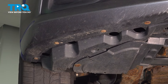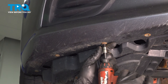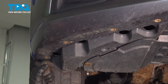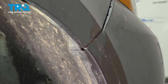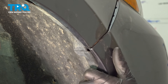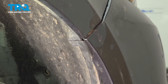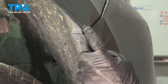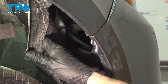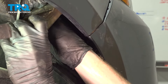After you have those out of place, we'll be continuing along each side. You're going to find that you have four Phillips head screws across each side, and then you can make your way into the wheel well. Now that we have those screws out of place, we'll continue making our way up inside the wheel well. Along each corner in this area, you're going to find that you have a mounting screw that you will have to remove. Take hold of the bumper cover, stretch it away from the inside wheel well, and then start carefully pulling the wheel well away from the area. Be careful for any pinch points — we need to bring it all the way up and hold it in place with something as basic as a chunk of wood to wedge it in there.